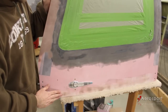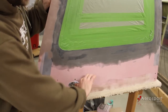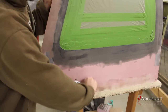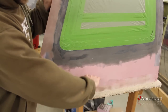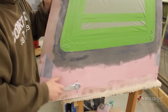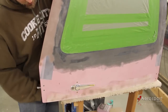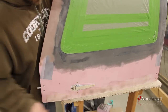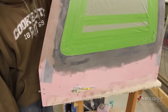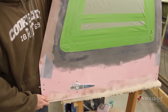With the lock installed, you're all done. Instead of having to push a button in and then turn the stock handle, you can just pull the lever out, rotate it, and it's open. Rotate it back and you're done. If you can't get your hand behind there, you can also just push on the inner part here, grab it, turn. And from the inside, everything works great. You lock it and it's not going to open. So there you have it — the Aerosport Products Low Profile Door Handle.